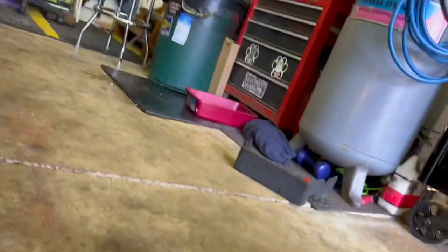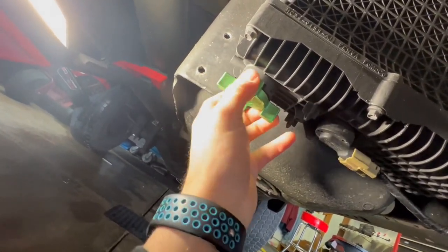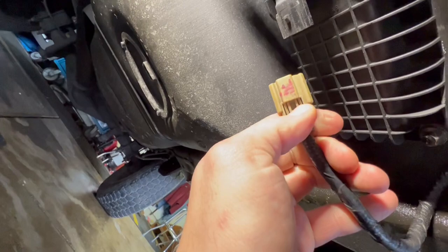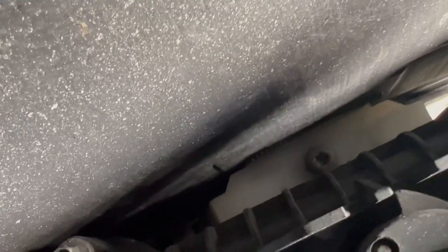There's that cover I showed you taking off — one plug, tree connector, and two that go to the side. This is what we're left with. This is the SPE drain valve that I put on which I won't be reusing, but this is the sensor we're going to be reusing right here. We're not taking it out — just going to unplug it. It's just a push connection — push here and pull, not too hard. We're going to drop this whole housing down and undo the lines on top. You got a T30 Torx right in there — that's it, that's how this bolts up.